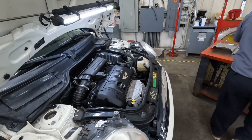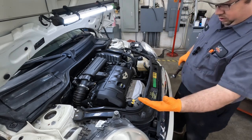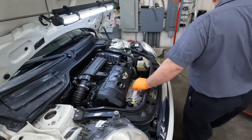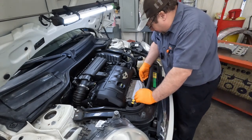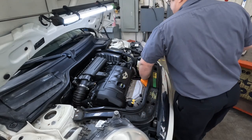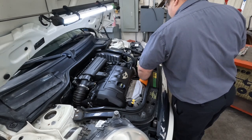Now, like I said, it's really not hard to move everything forward because you can put it in what they call a service position. That's going to take a ratcheting wrench, but you can put everything in a service position to where it will give you enough space to get into there without draining the antifreeze and all that. But if we don't have to do it, and it's not too bad, then I'm all for it. I can suffer through one job, I think. I just like space.